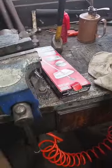reinstalled. And I read it took me, like I said, 60 foot pounds to get these bolts moving. But from what I read, Alf's Garage, and the guy seems like he knows what he's doing. Me, not so much, right? No professional at anything that I'm doing. I just do it. But he said it was around 30 to 35 foot pounds. So I'll go with 35 foot pounds around here and get that all locked back in. Oh yeah, she's sucking now.